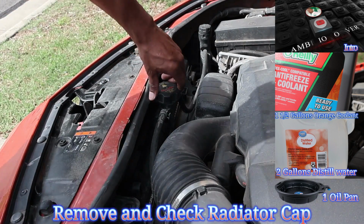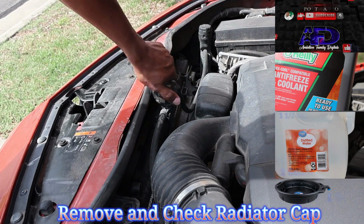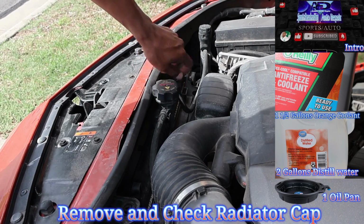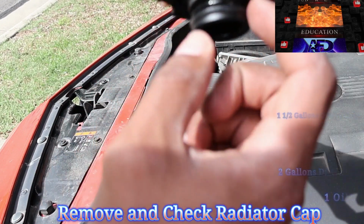In today's video, we are flushing the coolant out of a 2012 Chevy Camaro. All you need is 1.5 gallons of the orange coolant, 2 gallons of distilled water, and watching this video. Let's get it.